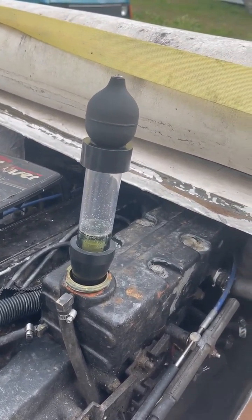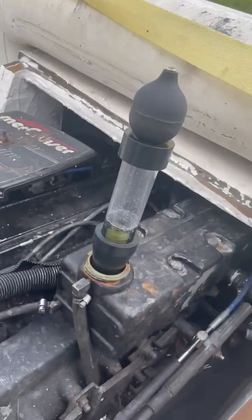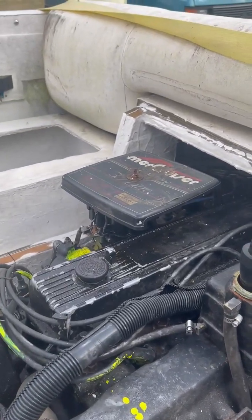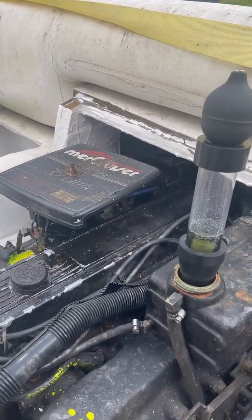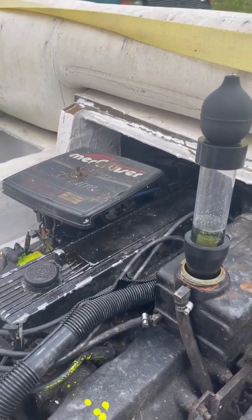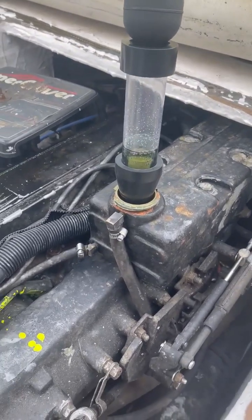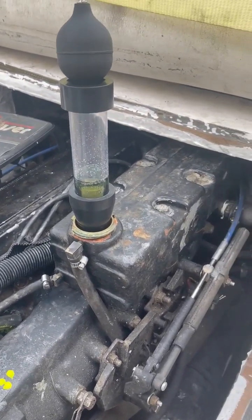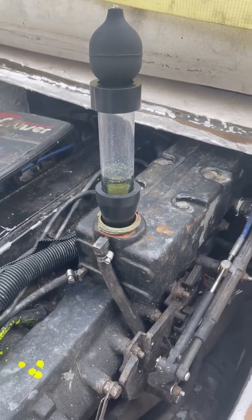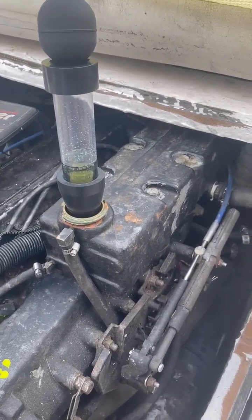The only difference was I used water instead of coolant. The service manual talks about using water with rust preventative because this is an aluminum block, so you need to use rust preventative in a closed cooling system if you use water as a coolant — and you only do that when you don't expect to freeze. I'm here in southeast Florida, so it doesn't get that cold here.